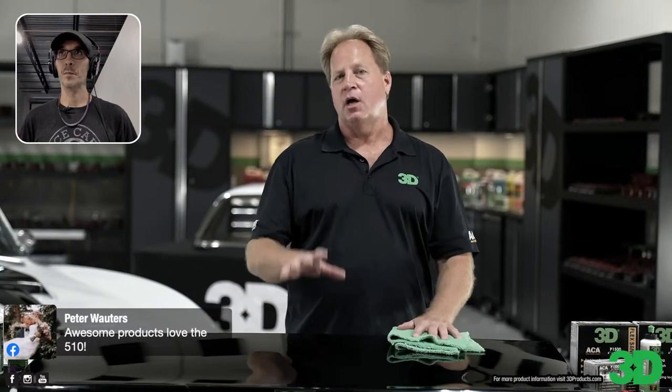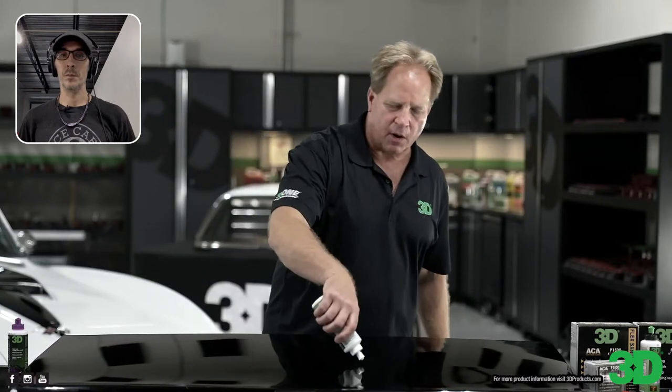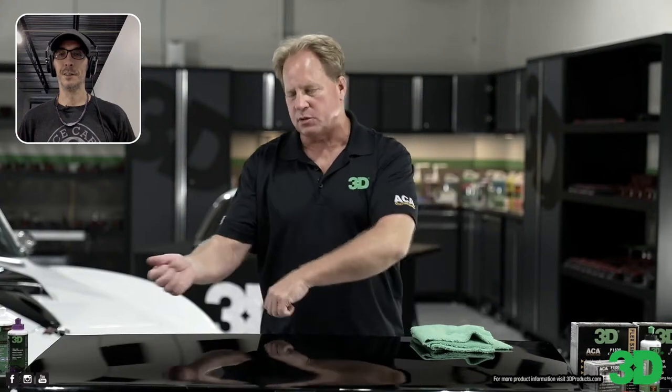In my classes, we do different cars and different types of detailing. One of them is after you're all done polishing the car, you come back and find what are called RIDs, random isolated deeper scratches. They stand out like a sore thumb because you've removed the thousands of shallow scratches around them. So you walk around, put a little mark on each scratch, come back with a wool pad on the rotary, take them out, redo that with an orbital, and it's golden. It's like you have a show car finish. So it's good for doing spot repairs like that.